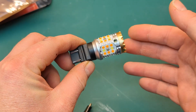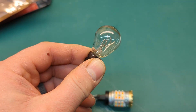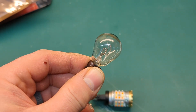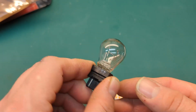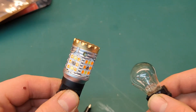This is a switchback. It basically replaces a dual filament light bulb. A dual filament light bulb has two independent filaments in it — one is a little dimmer than the other. Typically these are used in turn signals and the other filament is used for a running light when your headlights are on, and sometimes they're used for taillights and brake lights. There are two independent filaments in this light bulb, and that is what these switchbacks actually replace.